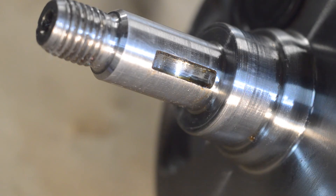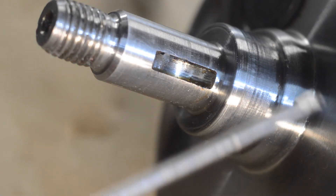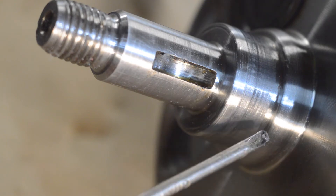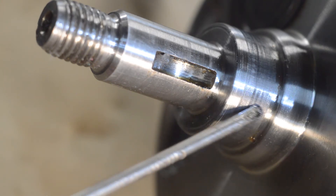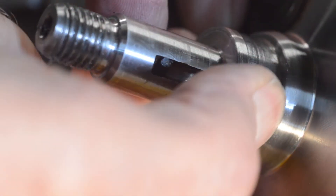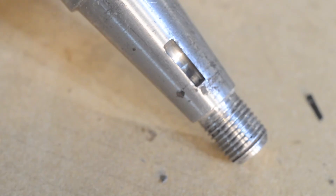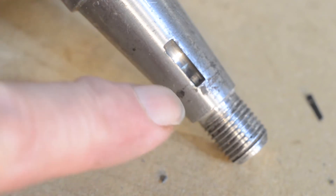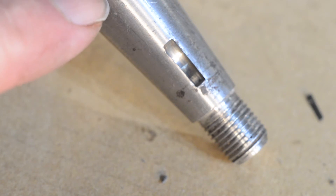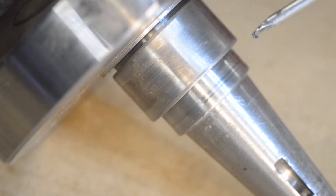Starting on the clutch side — the slot for the woodruff key is perfect, threads are perfect. The bearing sits here with the seal. There is very, very minor marking there — I don't know if you can see it — but certainly nothing to worry me. That will be going back in. It's just discoloration; can't catch anything on your finger. On the flywheel side, the threads are good. It's minor discoloration right at the very end of the crank there on the main taper — not bothered about that. Very minor discoloration where the seal sits.